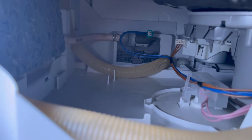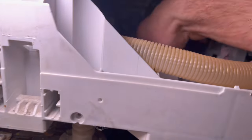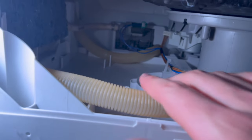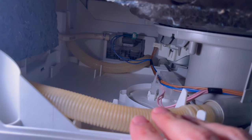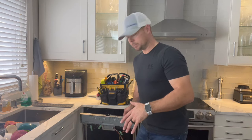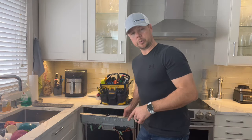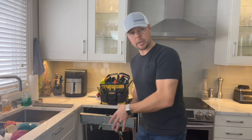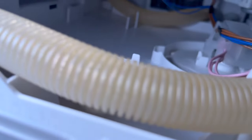Make sure that you have the issue solved before you put everything back together and start running the dishwasher again. I'm going to throw a few dish towels in here and just soak up all the water. I've dried up all the water and I don't see any cracks or any spots where there could be leakage through the drain. Power's back on, water's back on. I'm going to hold down the start button for three seconds to reset it, which is going to put it into drain mode and drain the rest of the water out.